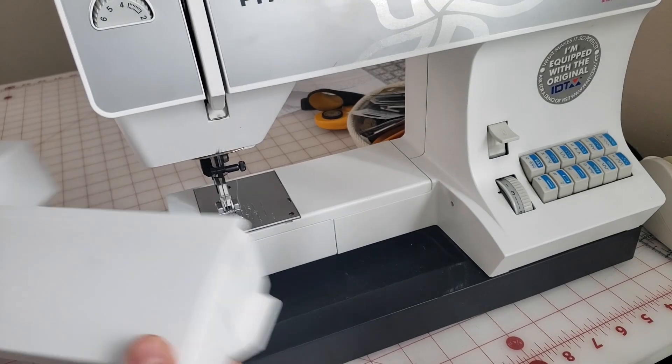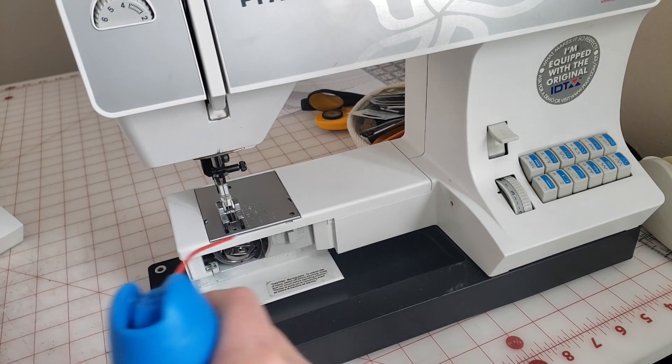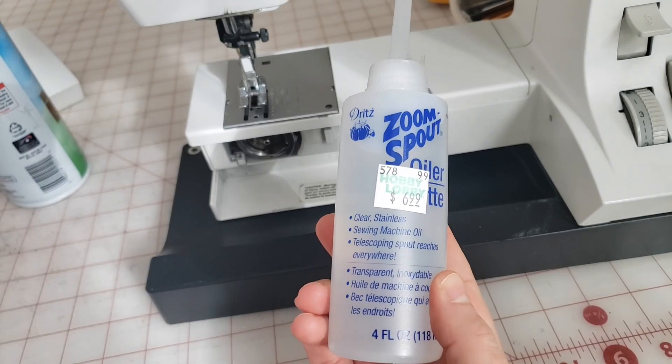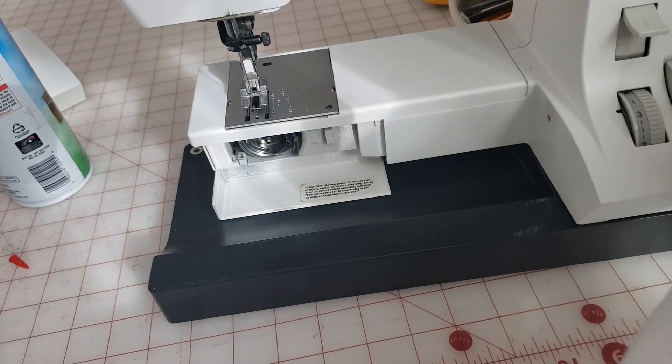On the topic of maintenance — you're going to eventually have to take your machine in and get it repaired. When I first got my Pfaff, I had to take it in quite a bit because I was sewing a lot and was really hard on it, and I wasn't keeping it clean. Now I am super diligent about keeping my machines clean because it does prevent you from having to get constant repairs. Probably every 10 hours of sewing, sometimes less — when I was sewing pretty much every day — I would go in and clean out the little crevices with an air can, and then put just a little drop of oil on the bobbin case to keep things running smoothly. That helps a ton and it takes like two minutes to do.